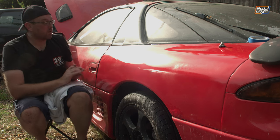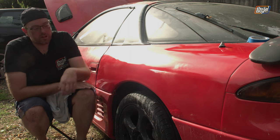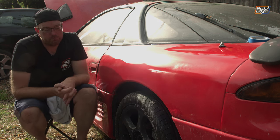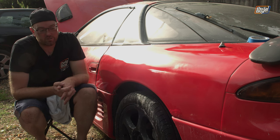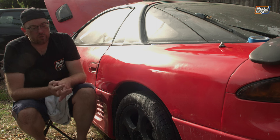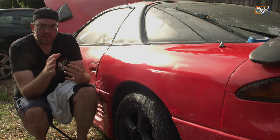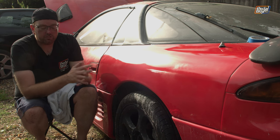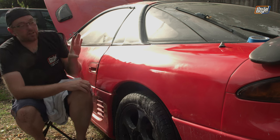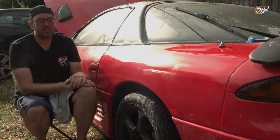And the reason I was quite happy to go at this quite cavalier and very gung-ho is because this corner has a big chunk of rust that's pushing its way up through the paint from the underneath. So that's going to have to be wheeled off. So I've got the paint wheels, take all that back and then smooth it out, obviously treat the rust and then repaint and lacquer it again. So if I did have to redo this entire panel because I screwed it up, I wasn't too concerned because I was going to have to put some paint on it anyway.